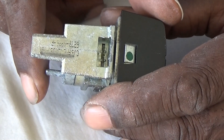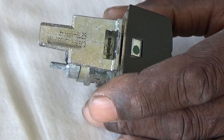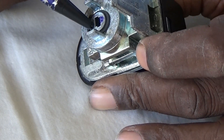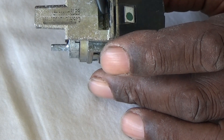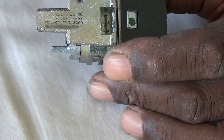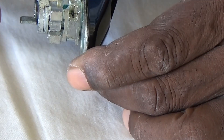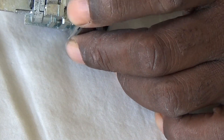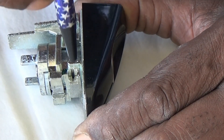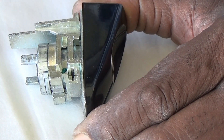This lock cylinder is held together by three different retainers. You have this one which is very visible right here, and then you have another one down in here that just is peened in — it has to come out. And then on the other side, there is another one right in here that just kind of drives through the other side.